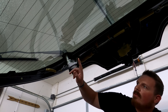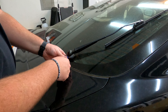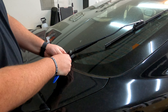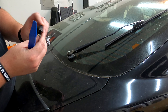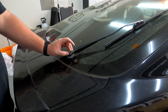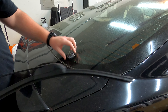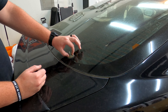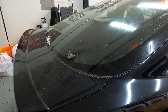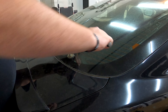There's one more bolt holding the motor. I'm going to pull off the wiper arm first and then pull out that last bolt. As far as the wiper arm is concerned, I've got my little plastic pry tool — this should just be a little metal cover that pops off pretty easily. There we go. This is actually plastic, believe it or not — I always thought that was metal. The only thing holding this on is a 12mm nut. Came right off — this has proven to be a lot easier than I remember. Then we've got this big nut right here that actually holds the motor to the windshield itself — not a 22, it is a very odd 23mm. Keep in mind, this hardware has been on this car for 16 years. The car is finally old enough to drive, ladies and gentlemen.